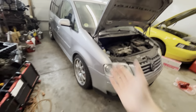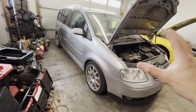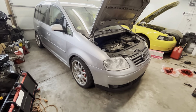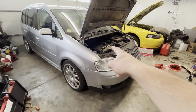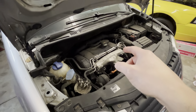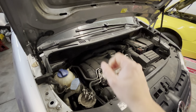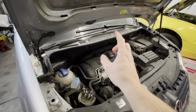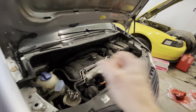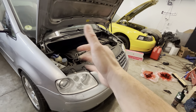I've just been busy. I have a new purchase — this is a 2004 Volkswagen Touran. It's my work vehicle and it is friggin cool. It's out of Germany. It's a PD-140, 2-liter 16-valve dual-cam diesel, Europe only. It's got a brand new refreshed head on it, a Dark Side Developments 1749 billet wheel turbo, and a Malone Stage 2-3 tune.